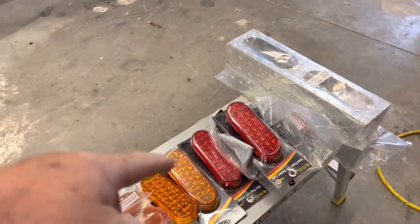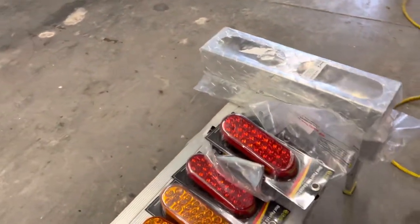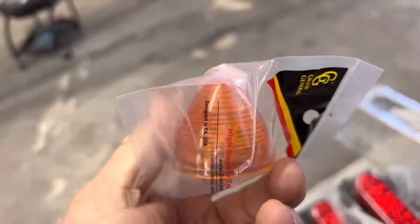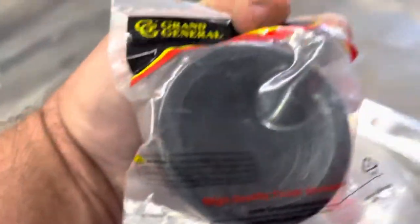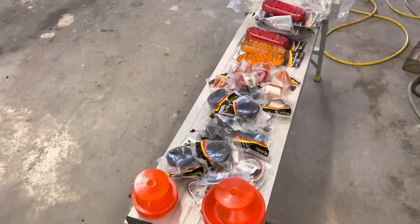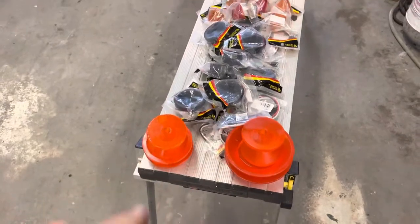We're going to go with an amber-red combo for the taillights, going into these taillight boxes right here. We're going to have backup lights — these are full LED, 10 LED beehive lights that light up the frame rails like crazy. I've got all sealed packaging to keep water out of the back side of the light, and we've got special push plugs that seal it off, plus special grease to keep it from corroding.